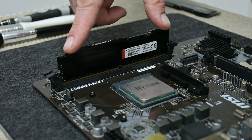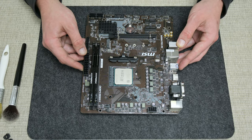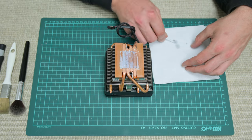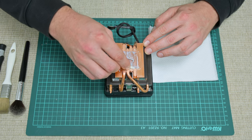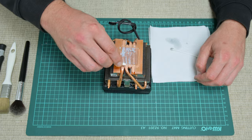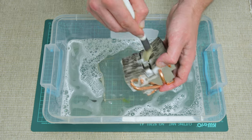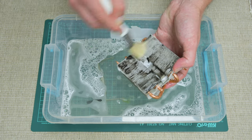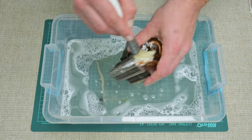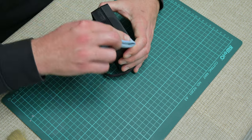After I clean and check the RAM, I place it back on the motherboard because later I'll take the motherboard for repair. Now I move to cleaning the other components. The AMD cooling fan is still good and functional — these stock cooling fans are actually still pretty good. The heat sink I wash using soap and warm water to remove all the dust and dirt. The cooling fan — the upper plastic part — I clean using brushes.